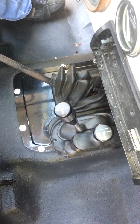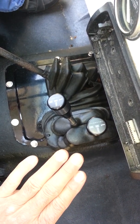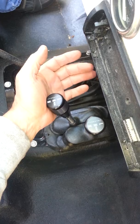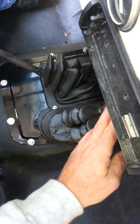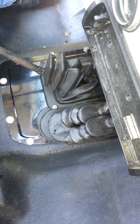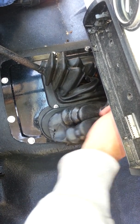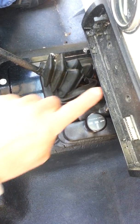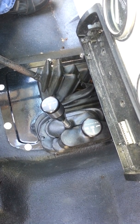If I want to go into four-wheel low — which really wouldn't happen that much — leave the right lever there and move the left one all the way up to neutral, then move it to four low. To come out of four low, always start with this lever first, put it to neutral, then move the other one all the way back to neutral. Now you're ready for the road.